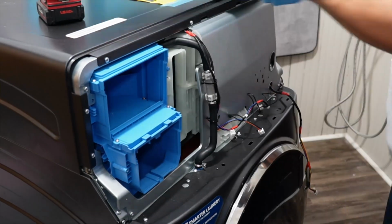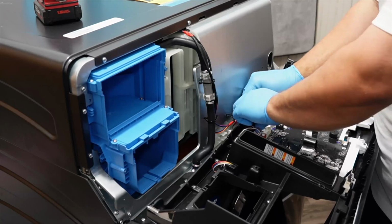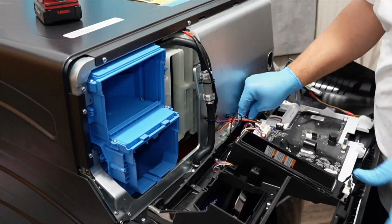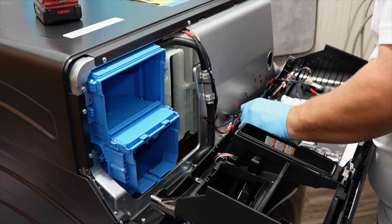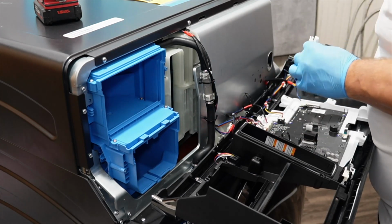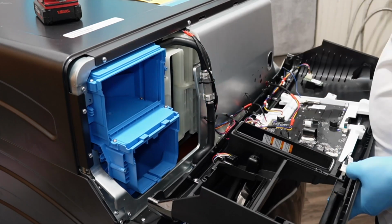With the top installed, it's time to go ahead and reinsert all the wires into the interface to get the last pieces of the machine reinstalled. If you have gloves, make sure to use them. You should have approximately 4 wire harnesses to install here. The NTC wire, the dispenser wire, the door light wire, and then the main control power wire. And you do have to route a lot of these through the zip ties or push mount ties depending on what you've chosen when you installed the heat shield.